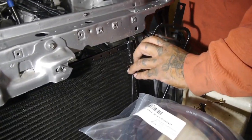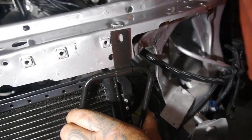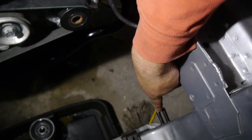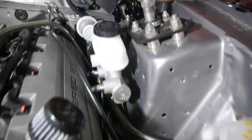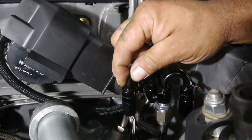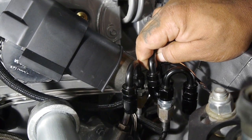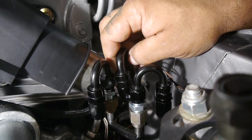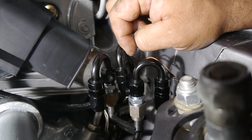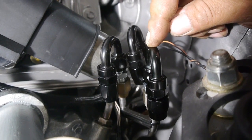Just to give you a quick layout: there's a little oval hole right there, clips up here, we had a speed nut with a screw down here, and our line sticking out right here. On our hydro booster, this line right here will be going to our power steering line, this line right here will be heading to our rack and pinion. These two lines are going to be pressure lines - I was informed by a follower that these hydro boosters can do about 1500 psi, so we're switching up these fittings.